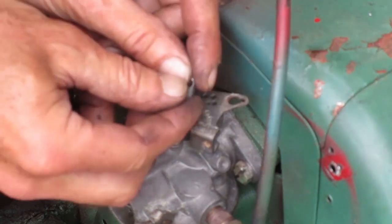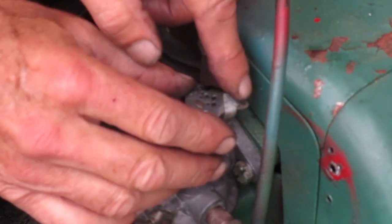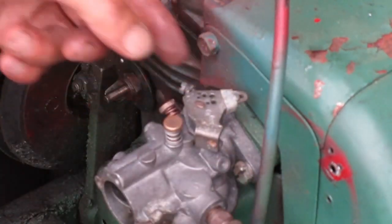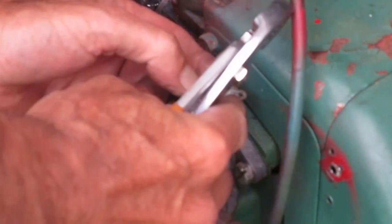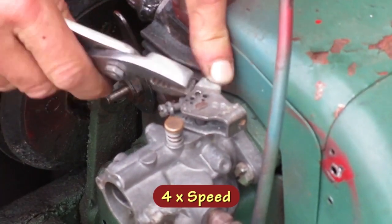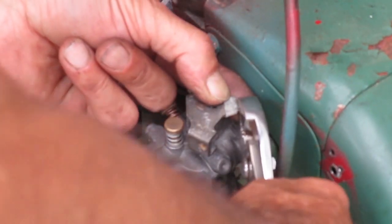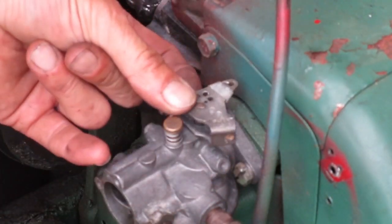That little protrusion there is folded over so it's double thickness. When I lay it on there, that protrusion goes down in that hole there and fills up the space. It's also bent down a little bit to fit in that hole and hold it in place. Then I'm going to bend those tabs around the bottom and it'll be clamped on there for good. That should leave me that little hole there for the linkage to work in. I want to make sure everything is mashed flat, and that folded over part is down in the hole there to lock it in place.